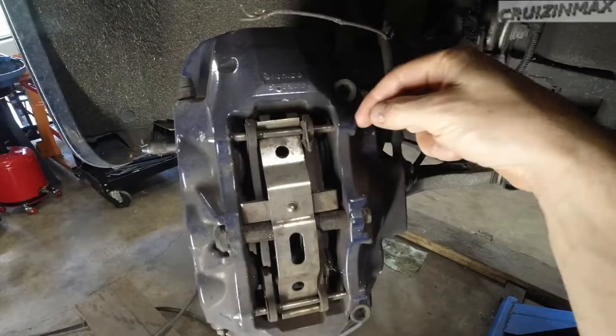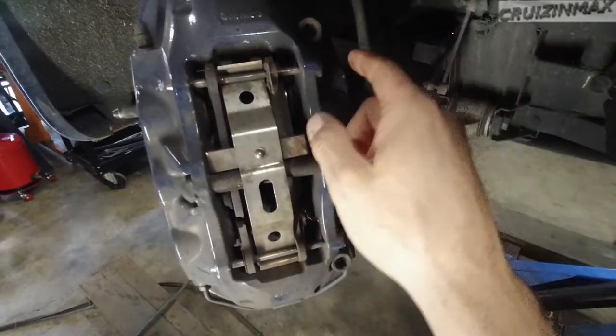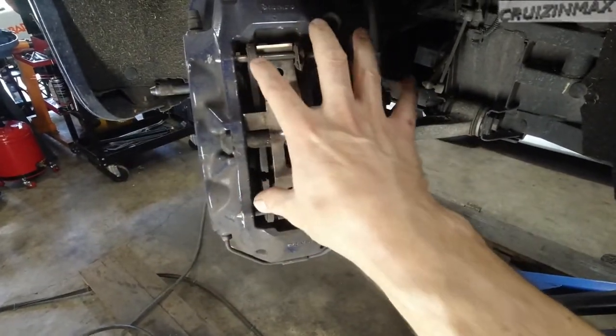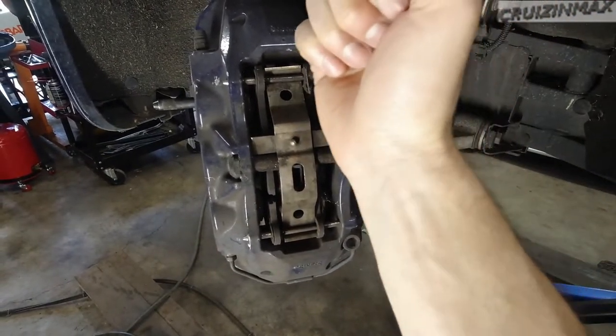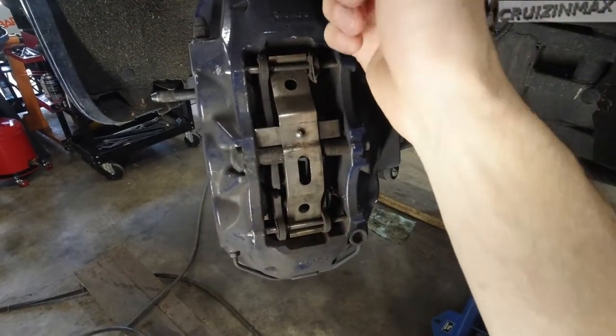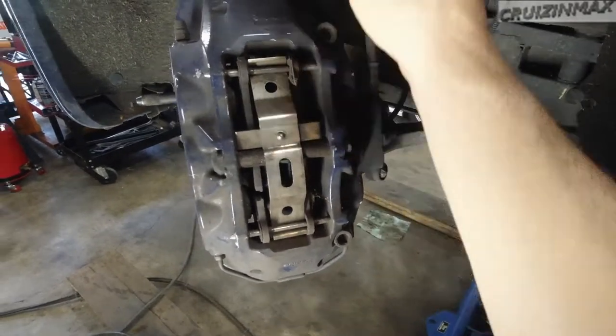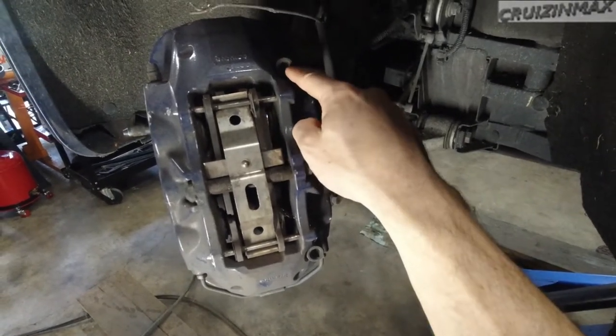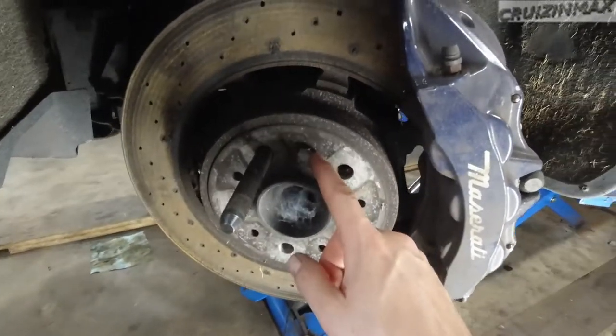Who's really at fault? What kind of mechanic was this guy working on this car? And if you own a Maserati, why are you trying to save money on your brakes — have someone do it in a parking lot? These are actually very easy to replace. These Brembo calipers — all you do if you want to just do pads is remove these pins. There are no clips or anything. Just little tiny pins — you knock one out, pull it out, then knock out the other, and the pads will slide out. Before that, you can put a flat screwdriver in between the pad and the rotor and try to press in the pistons. You got two on each side. Then if you're going to replace the rotor, all you do is take these — these are Allen, I'm guessing 12mm. These two and this whole thing comes out.